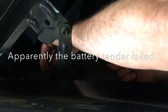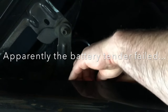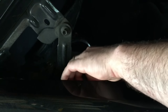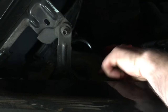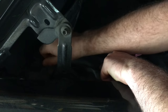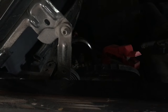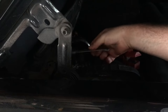The problem we're having is in a couple of days we're gonna need to take this truck and tow a big trailer. It has an exhaust leak on the manifold — a typical 5.3 with one of the manifold studs broken off. The difference here is that it's one of the interior studs, and there's not a lot of information on using one of the fixes like the manifold clamps. So I'm not entirely sure if a $23 fix is gonna be what we need here, because this can be a rather expensive repair.